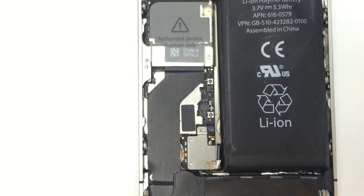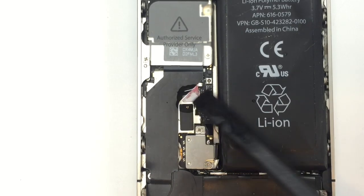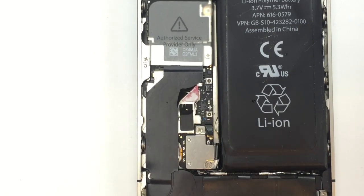In fact, it's so common that we'll often open up a phone for something simple like replacing a battery and find evidence of moisture on the internal components. This moisture will turn the stickers on the inside of the phone from white to red or pink as soon as they get wet. So for all practical purposes at this point, your manufacturer's warranty is voided.